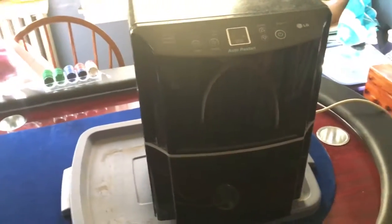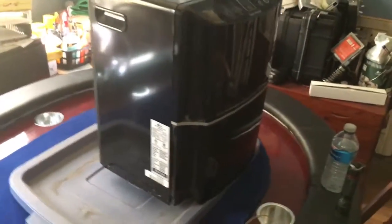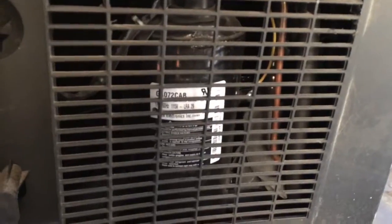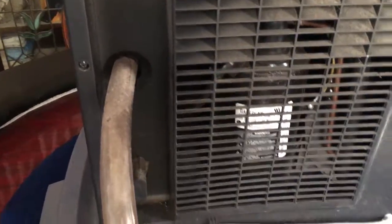What's up everybody, Rhyme aka Ekobooster here. My new project is my dehumidifier - I've had it a little over a year and a half. What it's doing is the compressor attempts to start but doesn't have enough and will trip its internal overload, but not every time. Basically that means the compressor is starting to get weak, and there's something we can do about that.